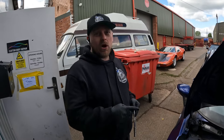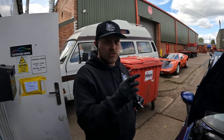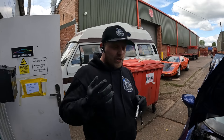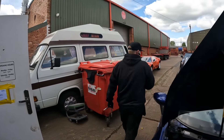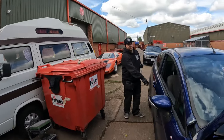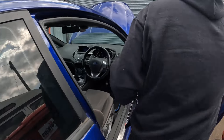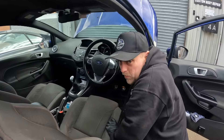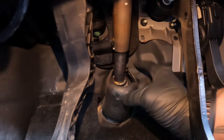Anyone that's not done this before, don't let that make you too nervous. It's literally a 10mm bolt - you slide it off. When you slide it back on, it seats nicely into its own position. Under here we have our clutch pedal with the master cylinder all integrated, and then we've got our steering column here. You have to pull this boot away to expose that 10mm bolt, and then it's just a universal joint.